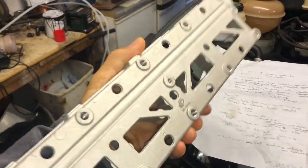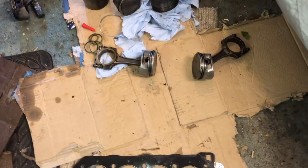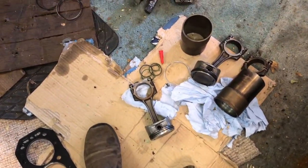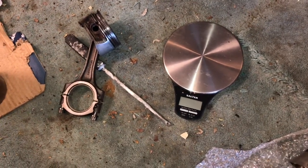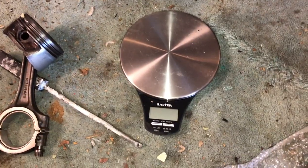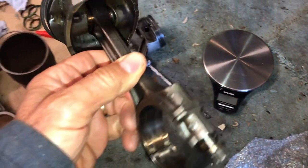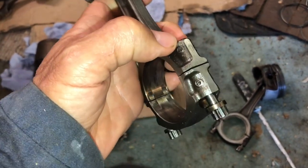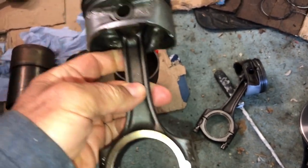Next do: use the stronger oil rail ladder, which looks like this and helps reduce flex on the engine. If you're taking the pistons out, it's worthwhile checking the balance on them, especially if you're replacing one or two. Get yourself some digital scales. I read that the factory balance tolerance was around eight to nine grams between pistons, which is quite a lot — obviously the lower the difference the better. These scales I've got have a resolution of only one gram; you can get 0.1 gram resolution scales. I've got a little bit of matching to do — these pistons are bought as a set but there's a slight difference in weight. I'm going to grind a little bit off around the end parts. Obviously you have to weigh them with the rings.